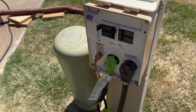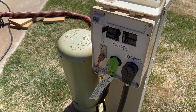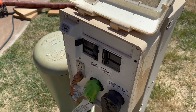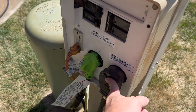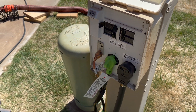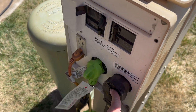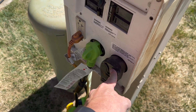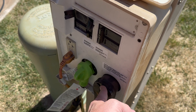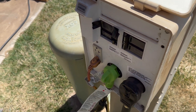As part of this travel day video, I wanted to share a little more about the electrical aspects of the RV. Most RV parks come with a pedestal that will have a 50 amp, a 30 amp, and a couple of 20 amp ports. In our case, the rig runs at 50 amps, so we plug in here. It's always recommended to have the switch turned off before you plug in and before you unplug — have it off, plug or unplug, and then turn it on.